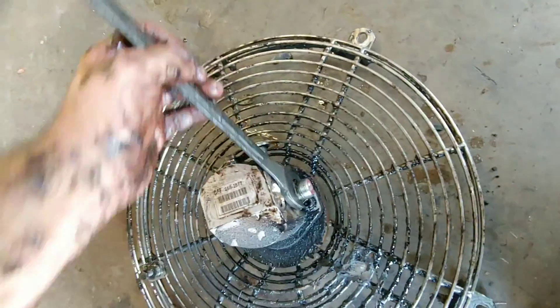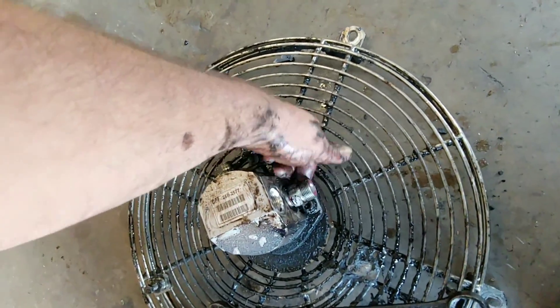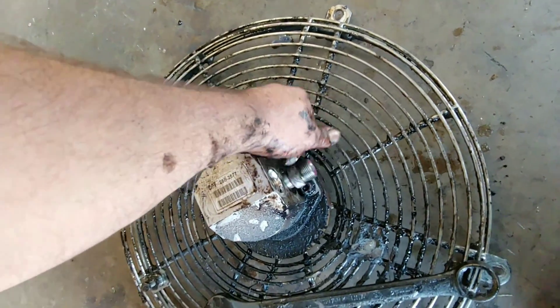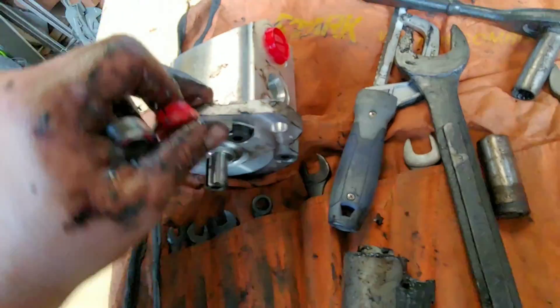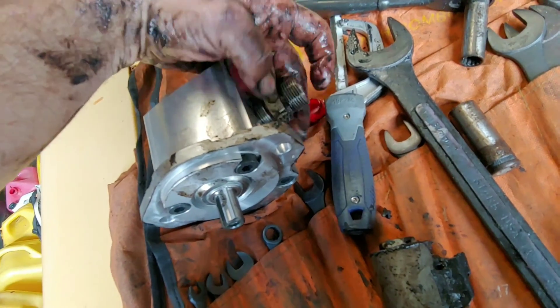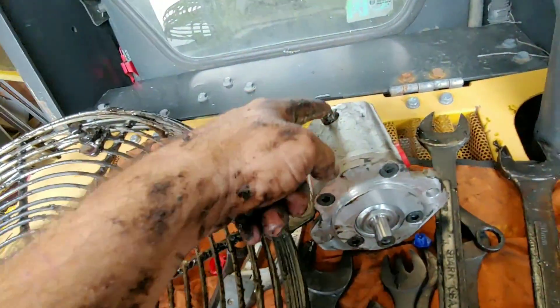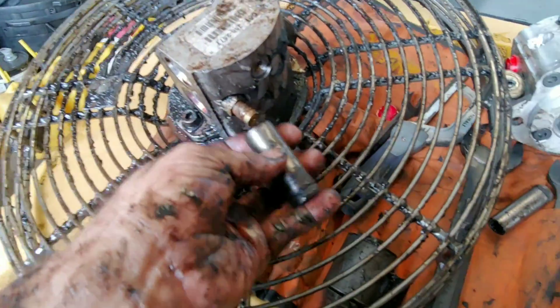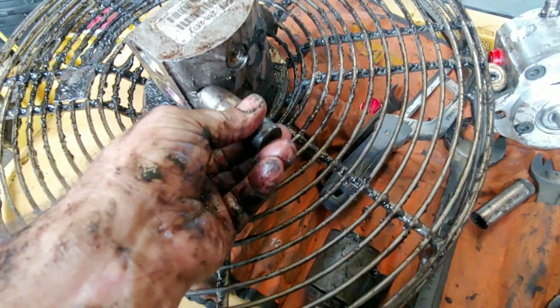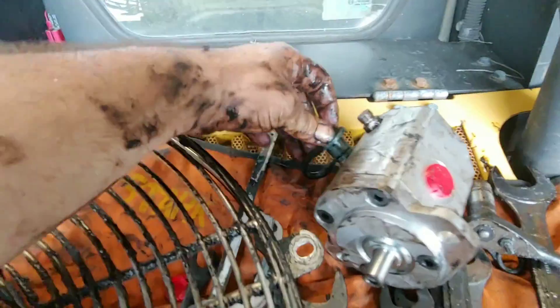A 27 millimeter will help you break this out. Now that this is free you can get a little more maneuverability out of everything. We can go ahead and insert that into the new pump. Take your 5/8-inch socket and remove this part, then put it on the new pump and slide it over. You want a deep-well socket so you can get it on there nice and deep, then take a ratchet and fasten it to the new pump. Put your protective cap back on and put these two fittings back in.